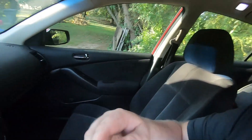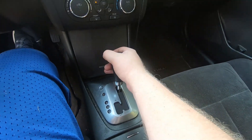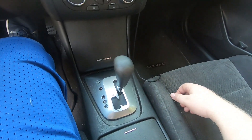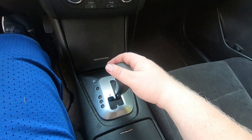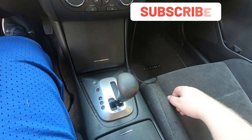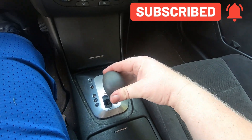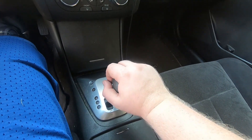Here's a trick while we're waiting for everything to warm back up: you want to shift your shifter — push your brake pedal like normal and go through each gear, holding it for maybe two or three seconds before shifting again. Go through park, neutral, drive, and the other positions, making sure you have your foot down on the brake the whole time, then come back up to park.